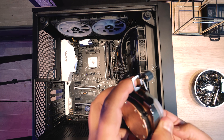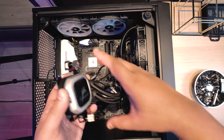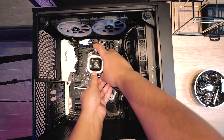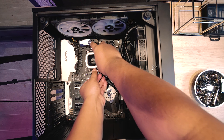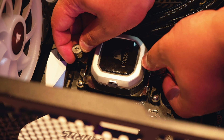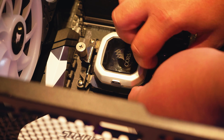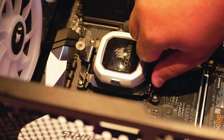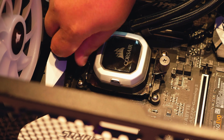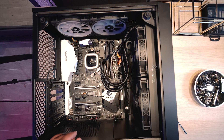Let's get this installed. Because we've used this cooler before, we've put fresh thermal paste on the CPU, ready to go. This will take a little bit of massaging — it's a little bit fiddly sometimes. These mechanisms are fiddly at first, but they usually have more mounting pressure than you traditionally find with coolers that use four points. I actually think these are better for AM4 sockets. Just tighten them until they're super tight and the nuts will stop rotating, so don't worry — you're not going to break anything.